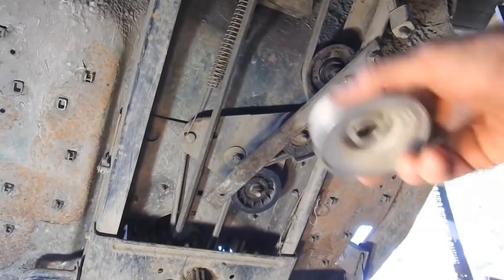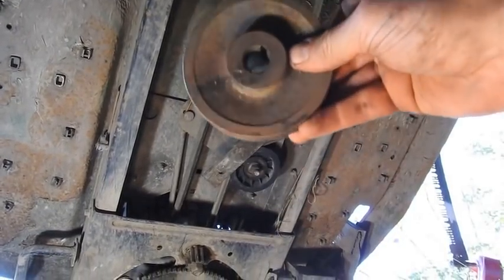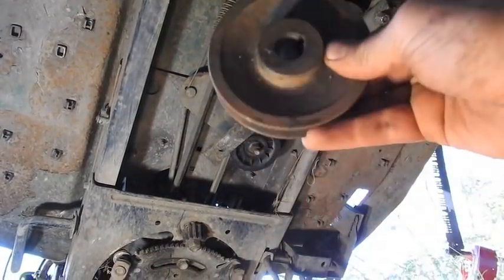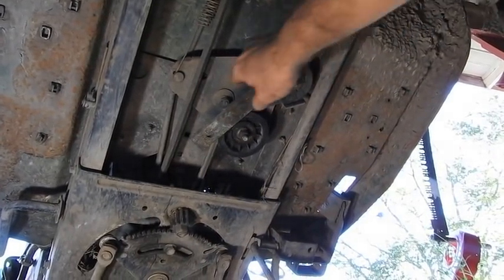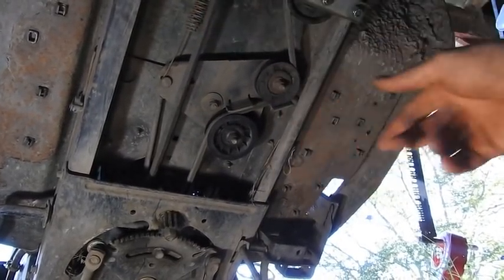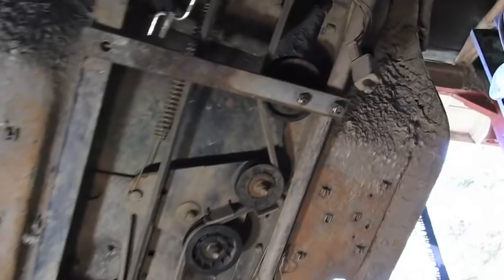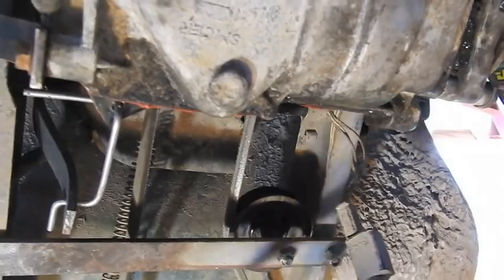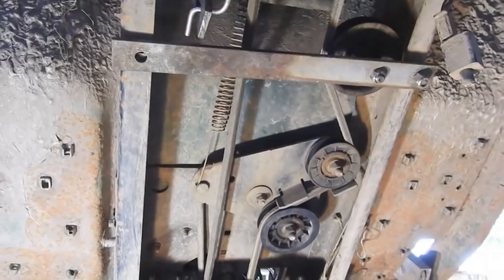So under the Deere, and I had this 3-inch pulley on, but there's no way I can make that belt work. But I found these pulleys last Saturday for $3 each. They're adjustable. I got them as wide as I can make them. The other one I found too, the other one's on the Deere now. And I've made this idler pulley adapter bar. I'm bolting it on right now, and that's going to make my belt tight enough. New belt, $19.99, plus you've got to take the steering loose to put it in. It's a little bit of a pain, and I'm going to make it work with this additional idler pulley. So I've got to tighten this bolt, this bolt, this bolt, lower it down, put the tires on it, go for a ride.